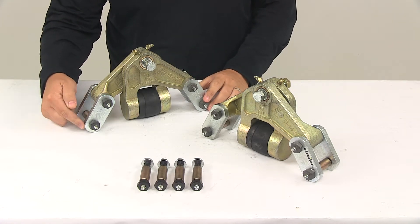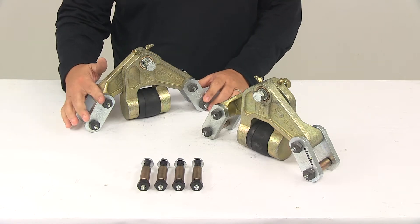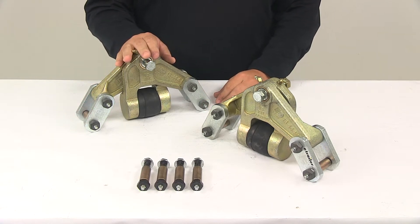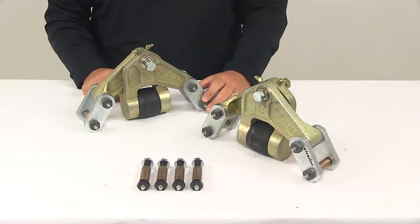The shackles are included — all necessary shackles come with the system. They have a length measurement from center of bolt hole to center of bolt hole of two and one-quarter inches. These are designed for axles with a capacity up to 8,000 pounds per axle.